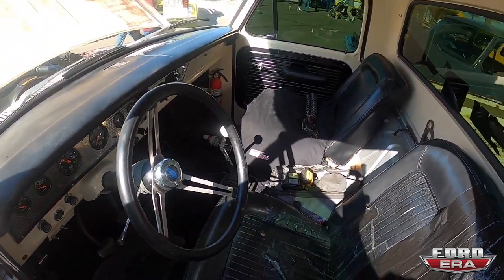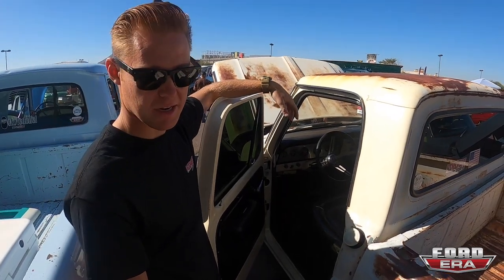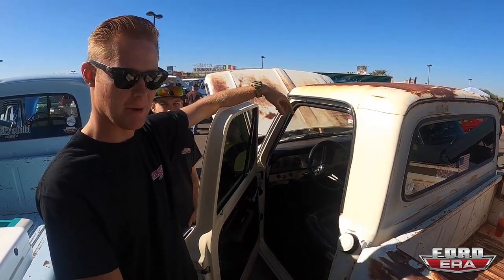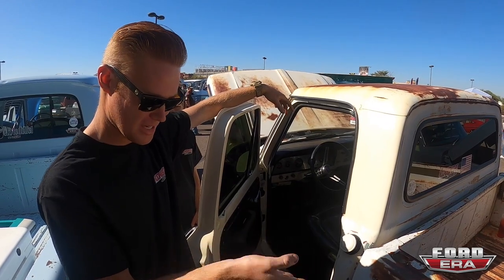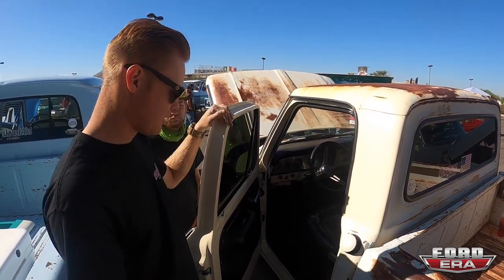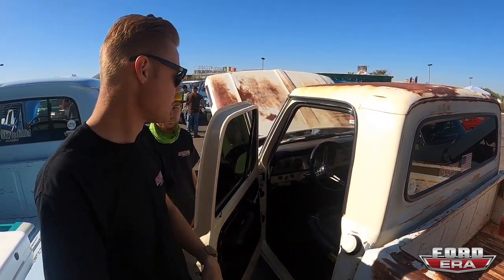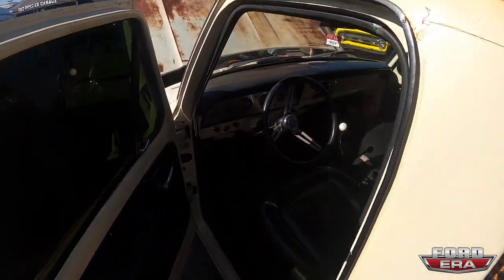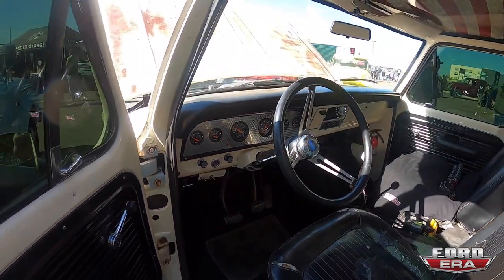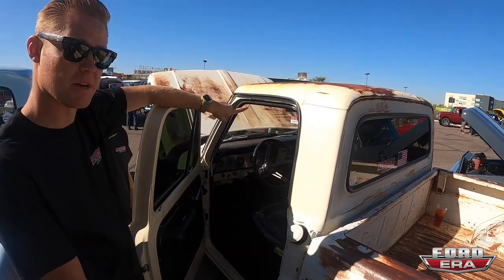Inside it's not crazy clean, but I did a Mustang bucket seat conversion — those are the factory bucket seats you can get in Rangers and Camper Specials. I found a 1969 F250 Ranger that had actual Mustang seats in it, paid $300 for the truck just for the brackets and seats. They bolted right in. I'm pretty tall so the bench gets you sitting up high; these let you sit lower and further back, which works really well with the Tremec. It's got a Steeda Triax short shifter, stock Z-bar stuff, a set of Auto Meter gauges, and a newer dash.